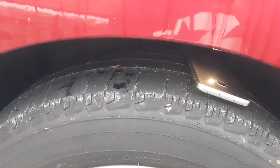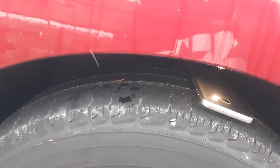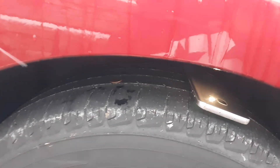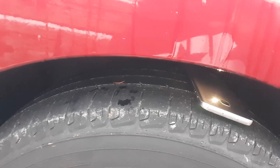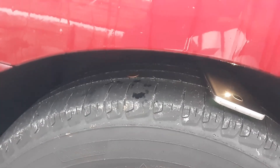Then there's just the age of your tire and where you drive. For example, I live in Florida. If you live in a real Southern climate like Texas, Southern California, or Louisiana, the hotter the pavement is on the road, the tougher it is on your tires. The hot asphalt will wear down your tires. And of course age — if a tire's over six years, it's probably a good time to get it replaced.